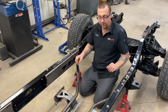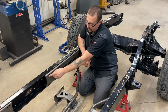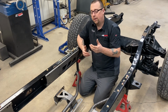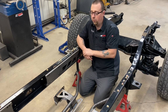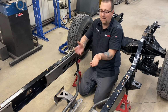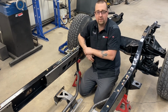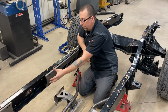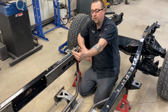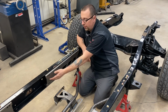We're going to lift up the front into position followed by the rear, or you can have someone help you. Now, one thing you might notice is that all of these C-channel plates have 2 bolt locations for each position. That's because on these trucks, if you're running a lowered truck, usually 4 inches or more, you're going to notice that your wheelbase, if you're using trailing arm rear suspension, starts to look a little off. As you lower those trailing arms, that's actually pushing your rear axle rearwards. So if you're running a 4 to 6 inch drop or airbags in the back, you'll probably want to install the whole assembly in the forward holes, which is going to allow those trailing arms to recenter your diff in the visually correct location in the wheel well. If you want a stock location, you're going to use the rear holes.